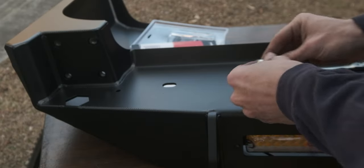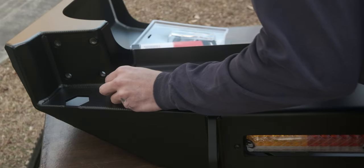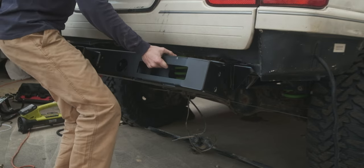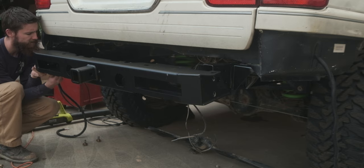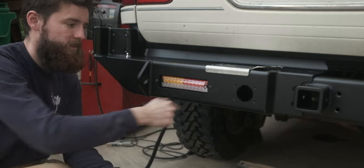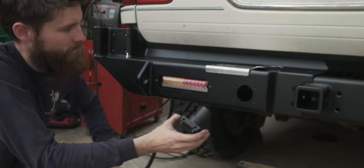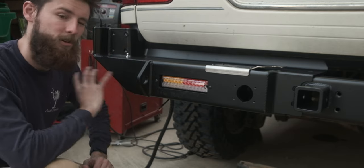I'm installing a swing arm on the driver's side. 13mm nut, 10mm bolt. I had to drill out the holes in this bracket because the 1/4-20 bolts wouldn't fit. I found out that you should not install the trailer harness connector into the driver's side wing before you install it. It's easier to get it on and then put that in there. I kept hitting the cross member with the end of this connector, so it's easier just to get it all on after the wing is in place.